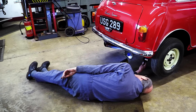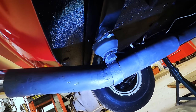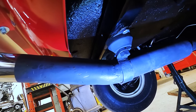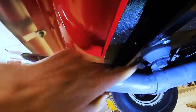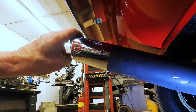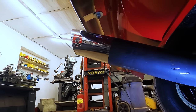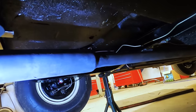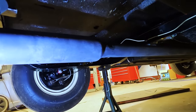So the pipe just comes along and comes to here, and then we've got my pet thing, which I always do. I use an engine mounting or a very serious rubber. I don't put those silly little ones on. And as you can see, that's a proper rubber thing. You can actually stand on that exhaust and it doesn't move. It's just an insulation, really. But anyway, we'll see. That might turn out to be all right. And let's face it, we all know that when you've got an exhaust that's a little bit noisy, you just drive it a bit gentle in the town.